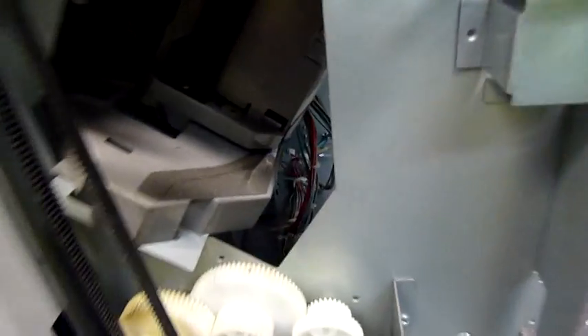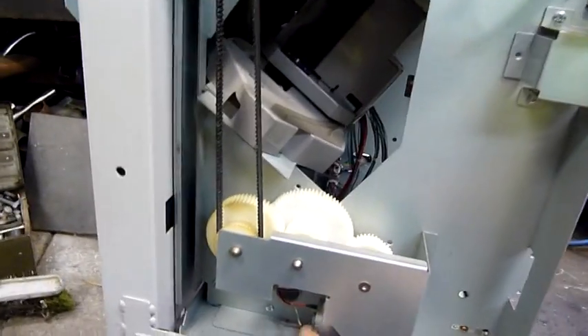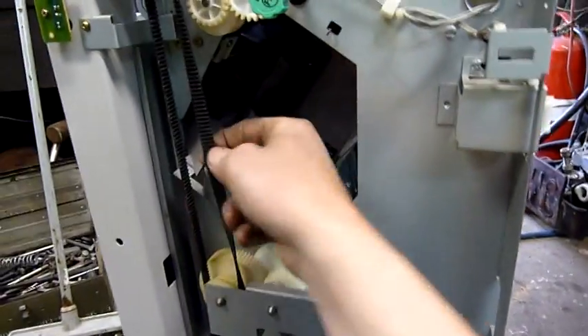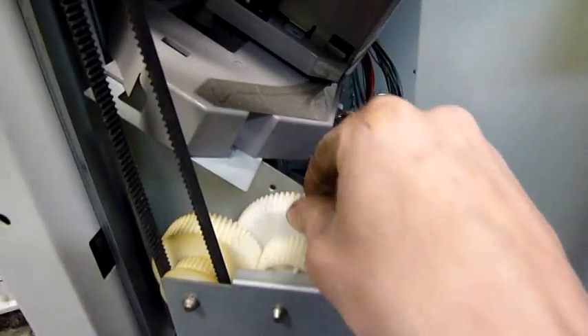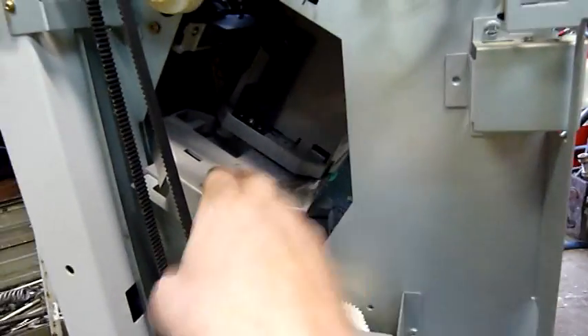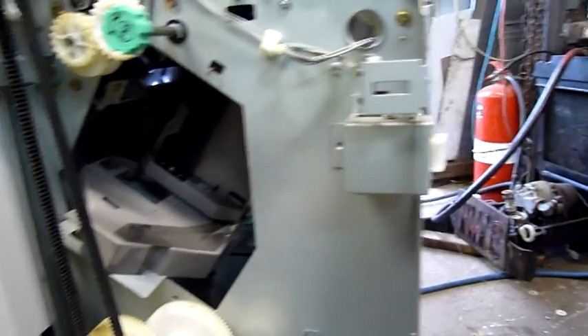That's the main motor for the elevator — it raises and lowers the sorted output tray. The belt goes up into there, all the way down, all the way up and back through — so it's just a very long timing belt. Some nice plastic gears. Most of this stuff's going to stay in one piece and go to the junkyard, but I will pull the stapler mechanism out and show you that one.